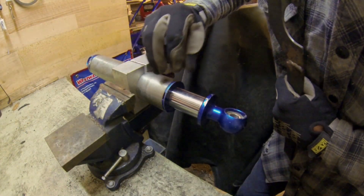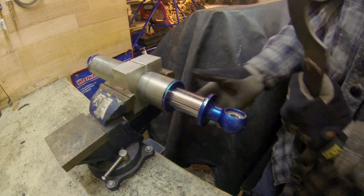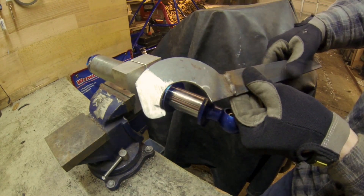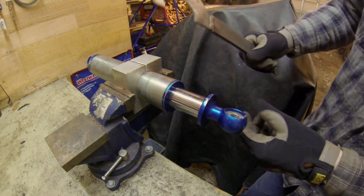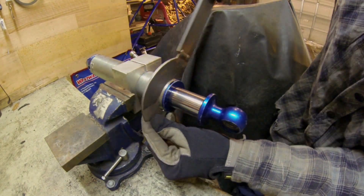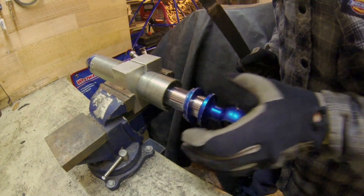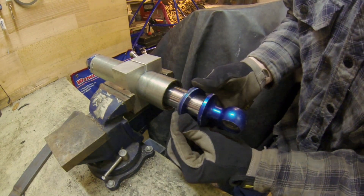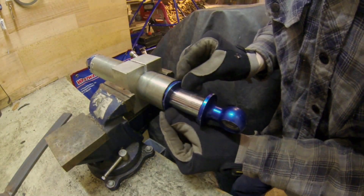You'll notice on the top of your shock there are semi-circular notches in the top collar. I've gone ahead and made this tool for myself that has a semi-circular notch that fits in there nicely, so I can lock in and twist it to pop that thing off. There we go — got it loose. It's not screwed on, it's just a snug press fit, but if you can twist it off like that with some kind of tool you'll be able to pop it right out.